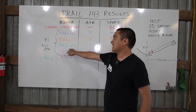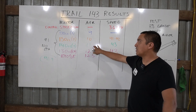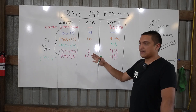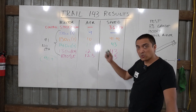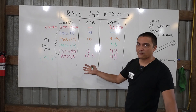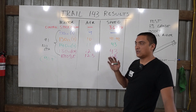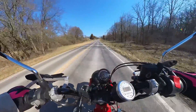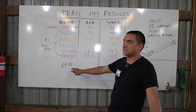Another reason I went back to the 140cc injector: our speed really didn't change between injectors anyway. Yes, it's richer — around 11.5 to 1 — but we didn't add an oil cooler to this engine. Having a little extra fuel in an air-cooled engine with no oil cooler helps cool the cylinder head. We've increased the heat in the engine with the big bore kit but didn't really do anything to increase cooling capacity. I wanted to keep it simple — no big oil cooler with a bunch of lines. The 140cc injector puts extra fuel in, yes it hurts fuel economy, but it cools the engine and prevents heat-related issues.